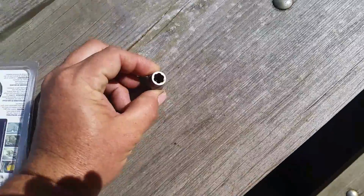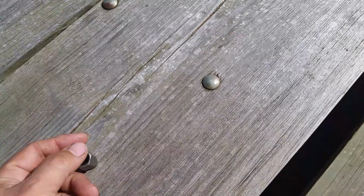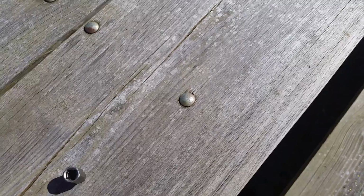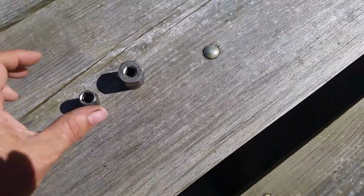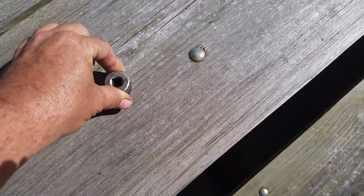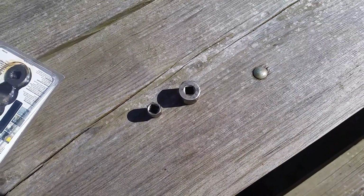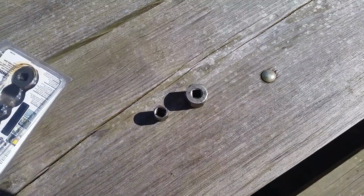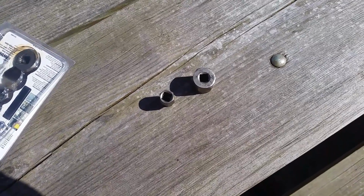Anyways, I think that's the first time I used this, and I used it with a brass hammer. You actually hammer on the back side of these on that surface. You wouldn't think you'd want to. This is the one we used on the Cavalier to get the bolts that hold the wheel bearing hub to the spindle out, because they were stripped. Somebody had used a junk T50 in there with an impact and had stripped them out. A virgin OTC T50 was just taking the internal out.